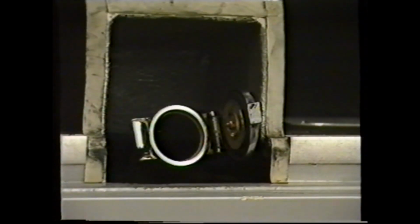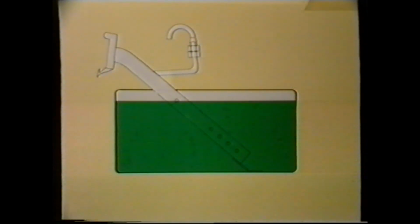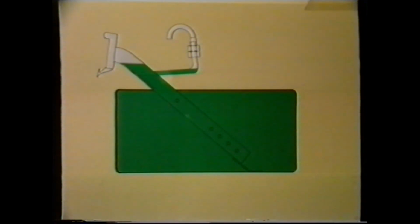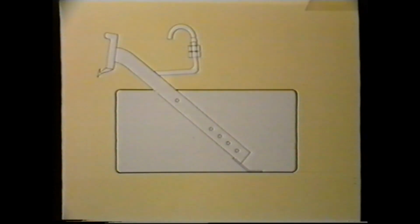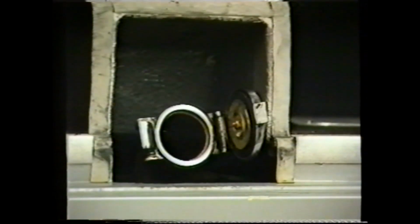Within the filler neck of the fuel tank, provision has been made to avoid overfilling. With the Cummins engine, it's necessary to leave 5% by volume airspace in the tank to take account of fuel expansion due to heat. Failure to leave this gap will result in slow engine die-down until fuel space has been generated by normal fuel consumption. When filling the tank, do not attempt to trickle fill the tank once the fuel nozzle has shut down. Otherwise, you will override this fuel level facility in the fuel neck and overfill the tank.